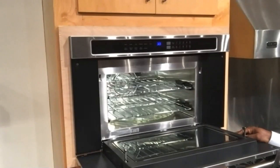Now, guys, this is something you do have to pay attention to, because if this was just a regular conventional microwave, it might have 1200 watts of power, okay? But because we're using it with the convection heater, it has 900 watts of power. So if you're using it as microwave only, you might have to cook your food a little bit longer. You guys that do a lot of the Hot Pockets or Lean Cuisines like I do know that the back tells you, based on your wattage of your oven, how long you have to cook the food for. So this one is 900 watts.